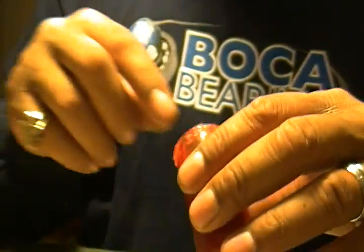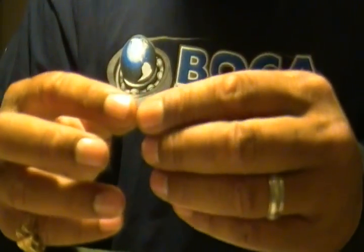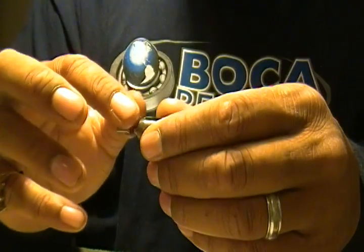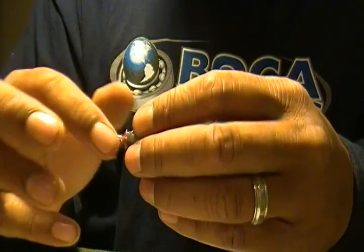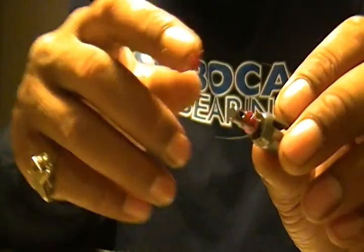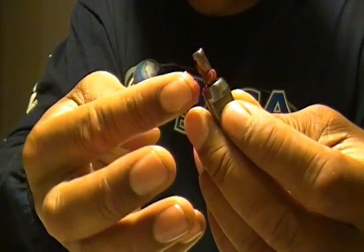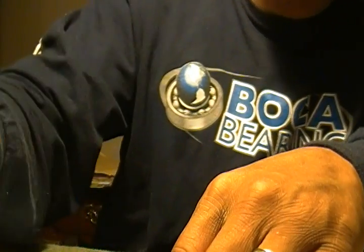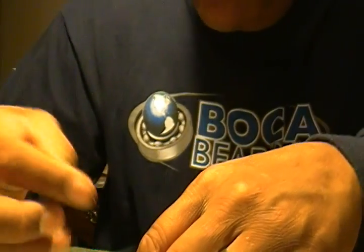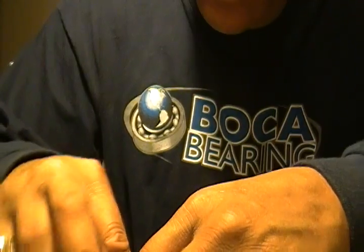Okay, now I'm gonna take my grease. I like to use the Mobil 1 grease, or you can use any kind of good synthetic grease. They got a lot of products out here, and I like it because it keeps that O-ring from leaking all your stuff out of there. Mine was real low because I burned it up. I was pretty nasty with it, so that's why I didn't have any leaks, because you'll have signs of a leaky diff, and then that's when you really jump on it.